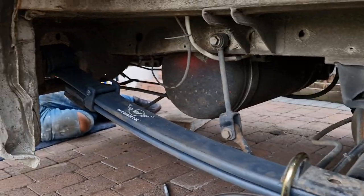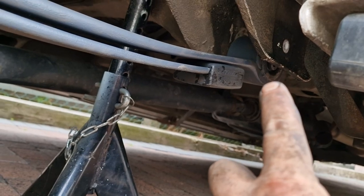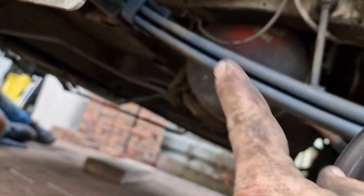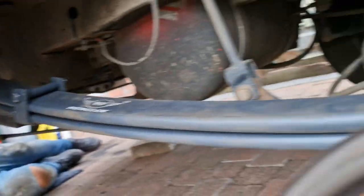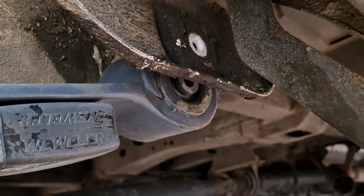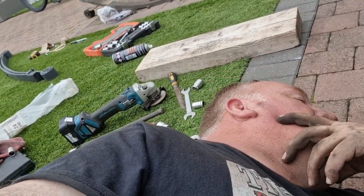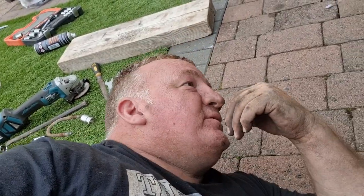Well it turns out there's a right way and a wrong way to put these springs in — we got switched when we put it in. Turns out there's 20mm difference between the front and the back. I assumed that was the back but that's actually the front — we're about 20mm short. We've got a little bit of adjustment at that end with the swinging joint, but it turns out we need to take this all back out, spin it round, put it back in, and hopefully that bit there will go straight in. As it sits at the minute it won't — so back to the drawing board.